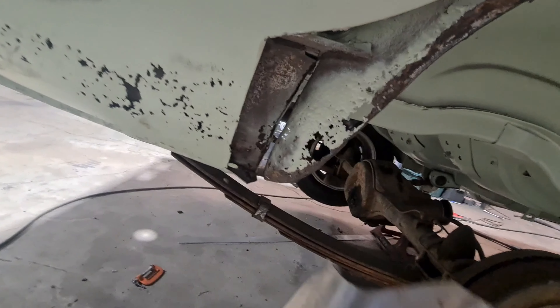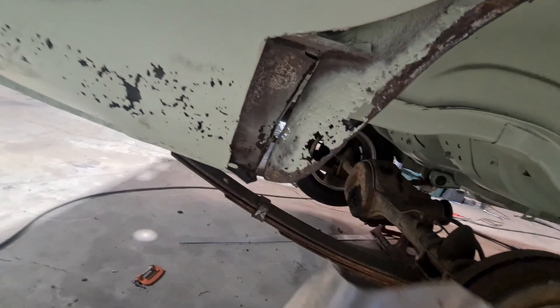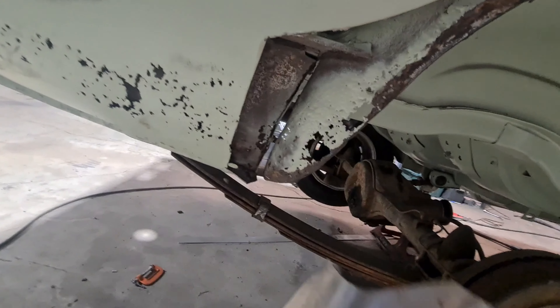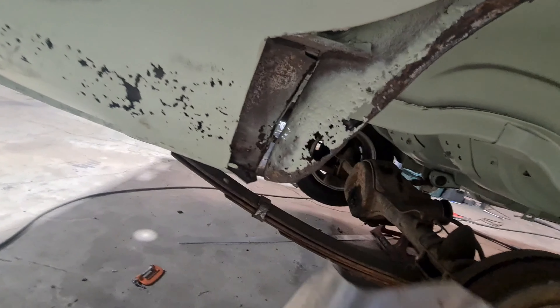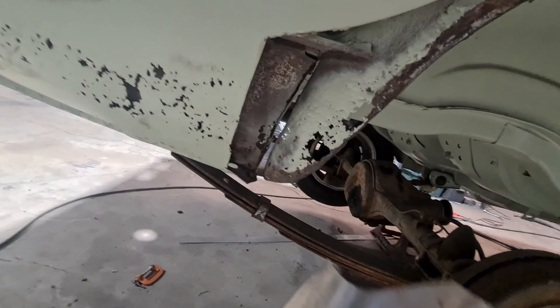Just sitting in place now — still got to tighten up this edge, chosen the back edge to tighten up. There's just a bit of damage to address on the actual door first — a dent there. Got all the inside where the skin's going to fold over cleaned up and ready to prime. Primed those areas and the underside of this skin. Obviously primed it before hemming it over, then gave it another dust over from where I'd scratched it.